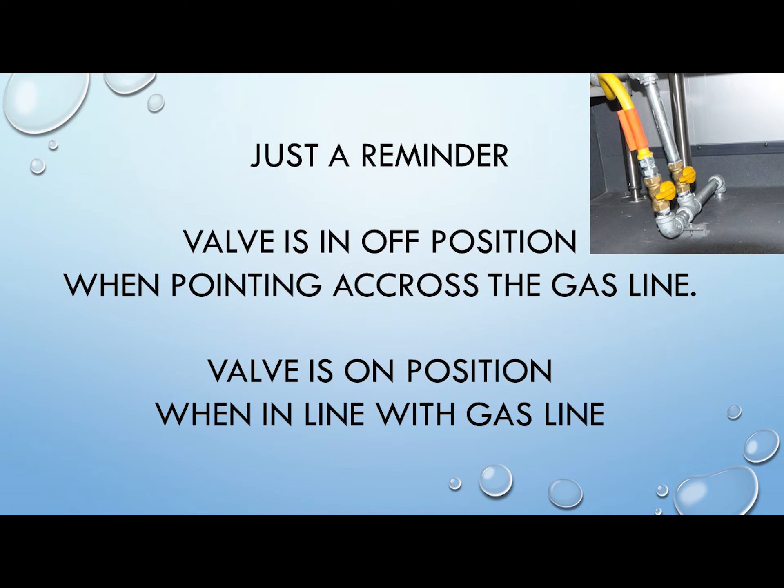At the end of the day, make sure that you close the main valve inside the truck, and then close your propane valve on the outside tank. It's always very important that every six months you have a propane company inspect your propane lines for leaks. If you have the smell of propane anywhere around your truck, you must notify a propane provider right away.